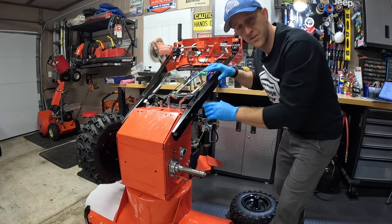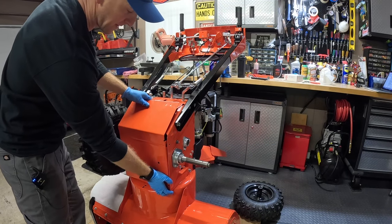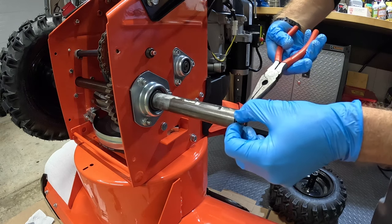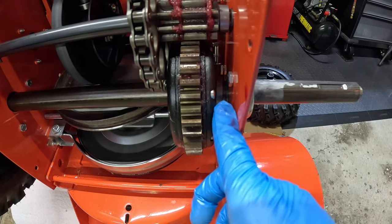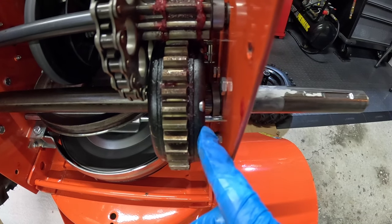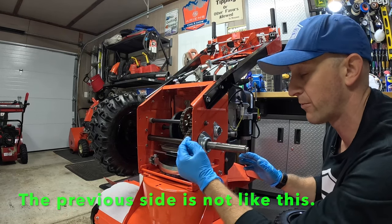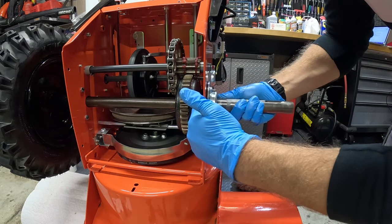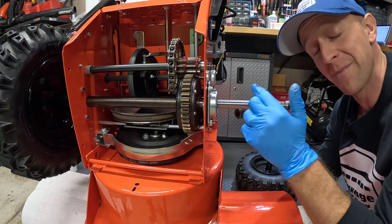Let's have a look at the other side. If you have an Ariens with an auto-turn system or some other model with a similar feature, you're going to want to pay attention to this. I already went a step ahead and unbolted this back panel. Similar to the other side, keyway's out, we're going to slide this bushing off. Then on the end there's a little clip — we're going to grab this with some pliers and pull it off. As we follow this shaft inside, we can see there's a washer or bushing inside. Pulling it out further, you can see there are little grooves or teeth that line up with the mechanism that helps the auto-turn. This shaft is actually two pieces — there's a tube that fits over a smaller shaft — so we have to make sure we realign those teeth properly when we slide the tube back over the shaft. My concern is that this tube will seize onto the inner shaft and make future repairs very difficult.